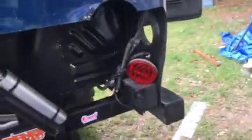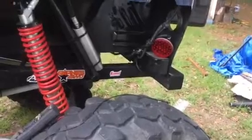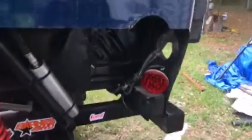On the way back from Jeep Beach, my brake lights went out. I thought it was a ground issue, so I checked it. I got my central ground back in there, pulled it out, cleaned it, put it back on. Still nothing. So I checked running lights. Running lights worked. I had those both share the same common ground, so I knew the wiring was all right,